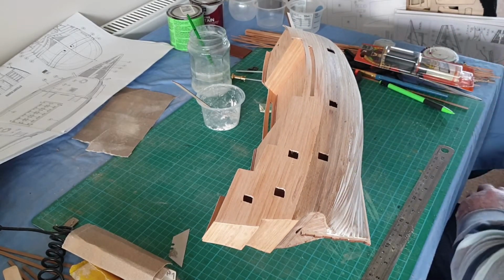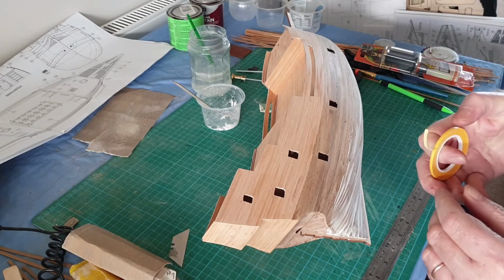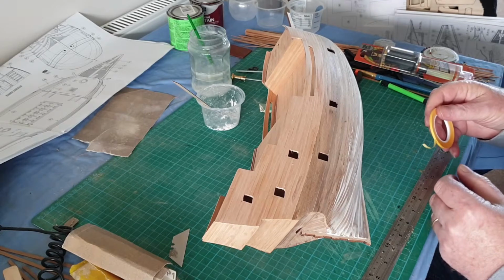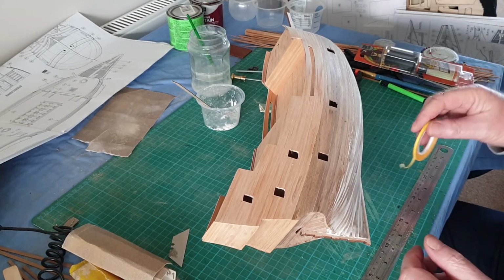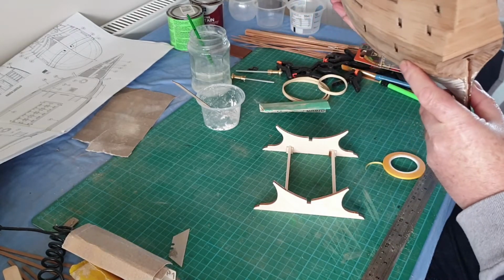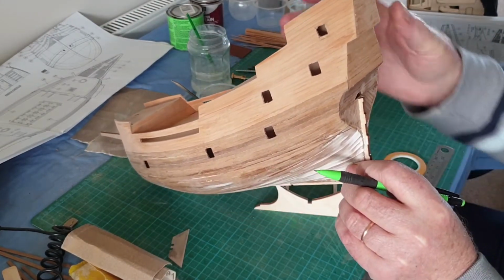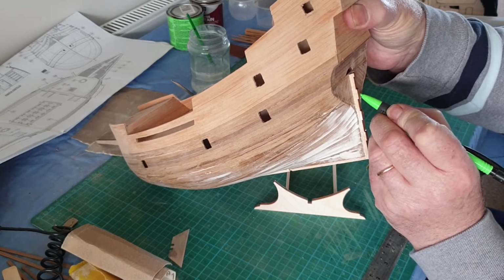So I'm going to paint the bottom, and first thing I've got to do is mask it off. Now I use this really thin masking tape, like pinstripe tape, to start off with, just to follow the waterline around, but make sure the waterline is visible and that you tape the right side of it, and then you can put a thicker masking tape on top of that, and then another masking tape on top of that with paper. But you'll see how we go on here with it, and there's a link below for a pack of this masking tape, which is in various sizes, starting off with this really thin one and building up.